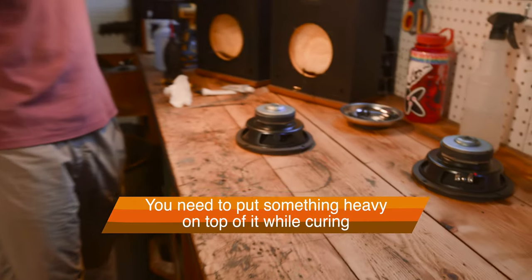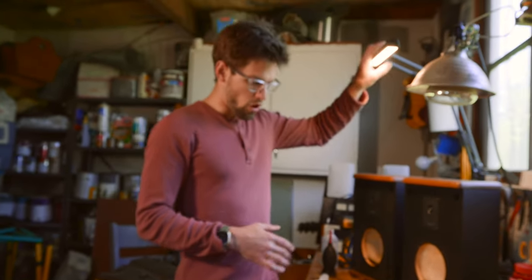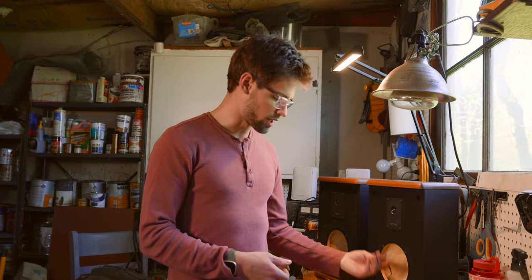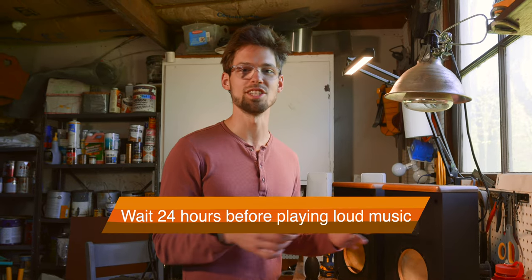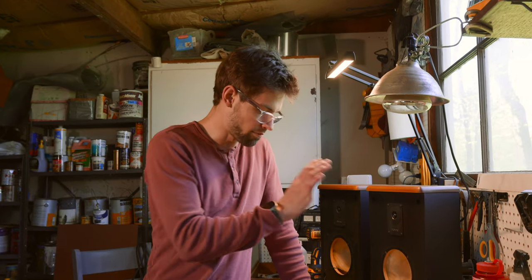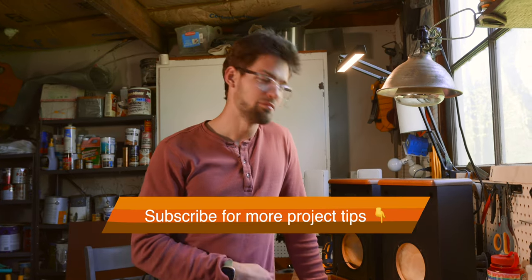Then you can just let this cure for a couple hours — overnight basically — now it's done. And so if you repeat this process with each speaker, you're going to be able to just clip them back on your wires, put them back in and listen to music, but you want to give it about 24 hours to let that glue fully dry before you go blasting any tunes. Otherwise you might just blow the foam right off the speakers. So give it at least overnight — 12 to 24 hours is a great range — but it's a pretty simple process. You know how to get it back in, attach the wires to it. If you do have any questions about this process or anything else with stereos, feel free to leave a comment below. I love restoring old stereos. And if you found value from this video, please feel free to subscribe and like the video. It helps me out a lot. Thanks for watching.